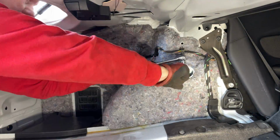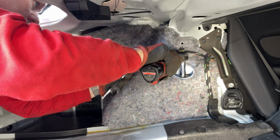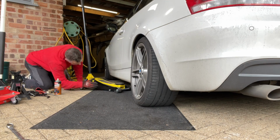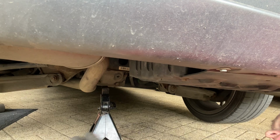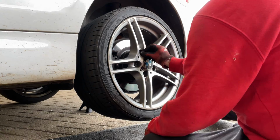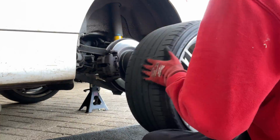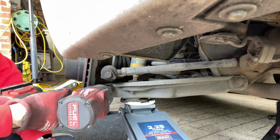We're going to do the same thing. I'm going to whiz through this really quickly though, but if there's any problems I'll slow it down and you can actually see what's happening. So you'll get the jack up again, have that wheel off, axle stand under it. Just getting that under the cross member there, in the middle, just in case it does drop, so it's not going to go anywhere and squash me. Locking wheel nut on there again, whiz those nuts out. We'll jack that up, take the tension off that bottom bolt, and then we can pull the bolt through.